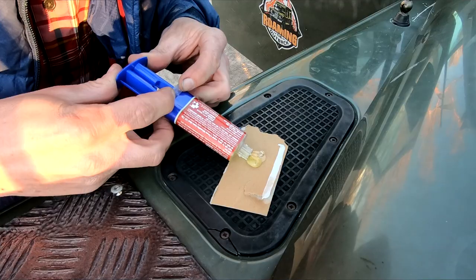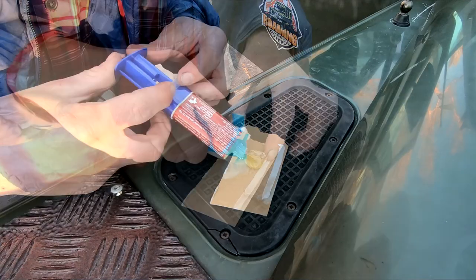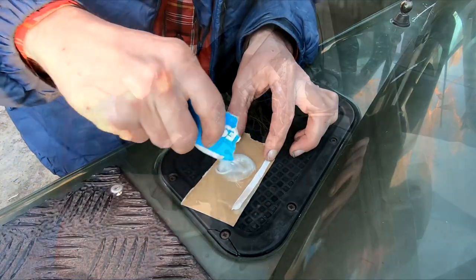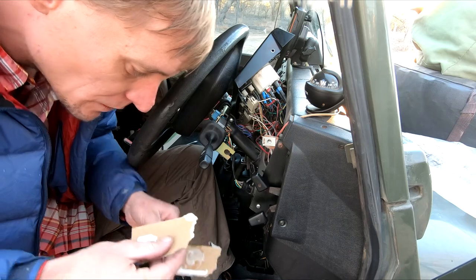It's an easy fix, unfortunately I can't take it off to glue it because it's got security bolts and I've already snapped one of the bolts off — that would require me to drill it out again, and I probably don't have a bolt of the right thread and size. So I'll glue it in situ: I'll get some Araldite mixed up, stick as much in there as I can, clamp it on, and wait. That should hopefully get rid of the play and then I'm back on the road.